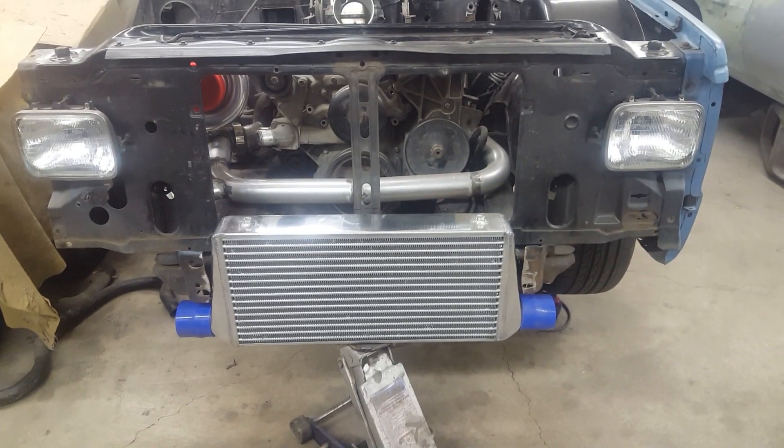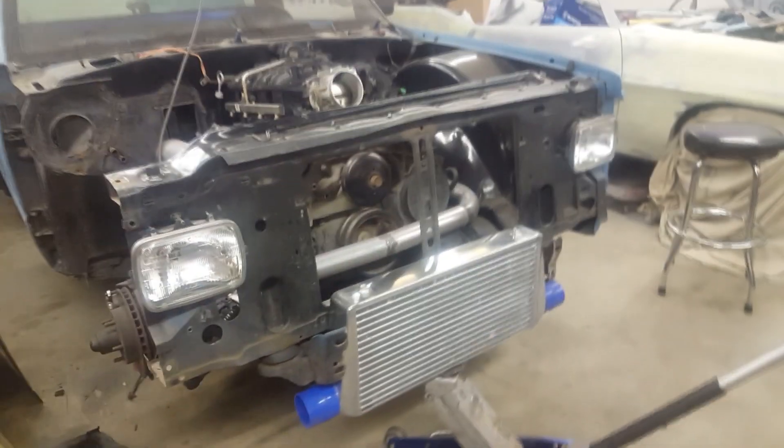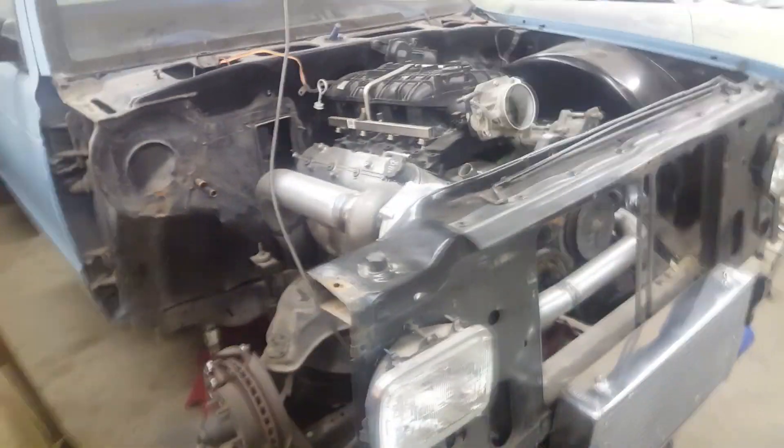It kind of sits on the outside from the factory, so I'm gonna cut a bit and get the radiator right inside there — kind of what we did on Mike's S15, we moved it in for more clearance for the engine, turbo, and everything. I might move it over to the driver's side a tiny bit so the turbo can actually get air from outside. The truck has air ride, and when it lays out the spoiler doesn't touch the ground, so my plan is to keep it close to the ground without catching, getting maximum air into both the intercooler and the radiator.